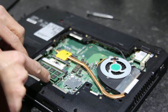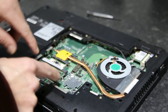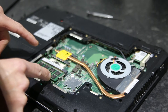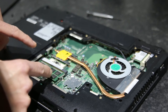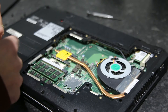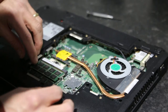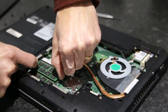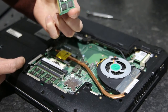This one now has two chips in. If you wanted to upgrade, you could take one of them out and put a new higher-capacity one in. The description will have details of the RAM chips you need. To remove a chip, there are two clips either side — just prise them to the side and the chip lifts out.